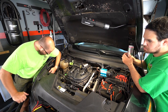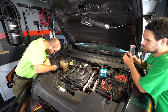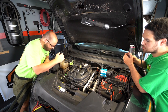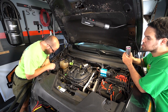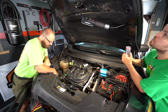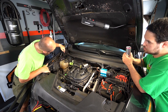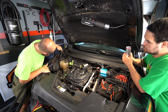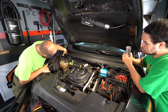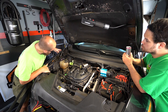We've got some wiring that we're probably going to clean up for Adam from our HID kit. And then we're going to come over, change camera positioning angles. I'm going to show you how to get rid of the lower U-pipe. Once that is done, we'll install all of the snorkel piece, route it up to here. This bracket right here will be removed. So you have a cut right there, a cut right there, and then a cut along the bottom as well. That whole piece gets removed because the hole will get drilled on this side right here.